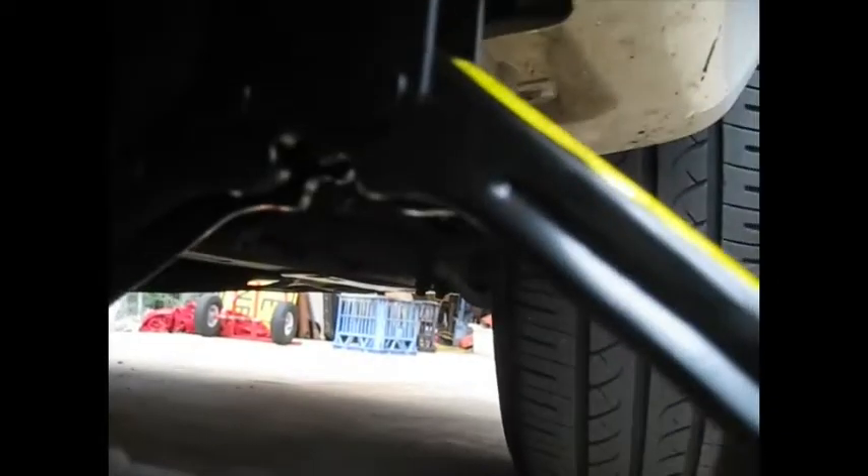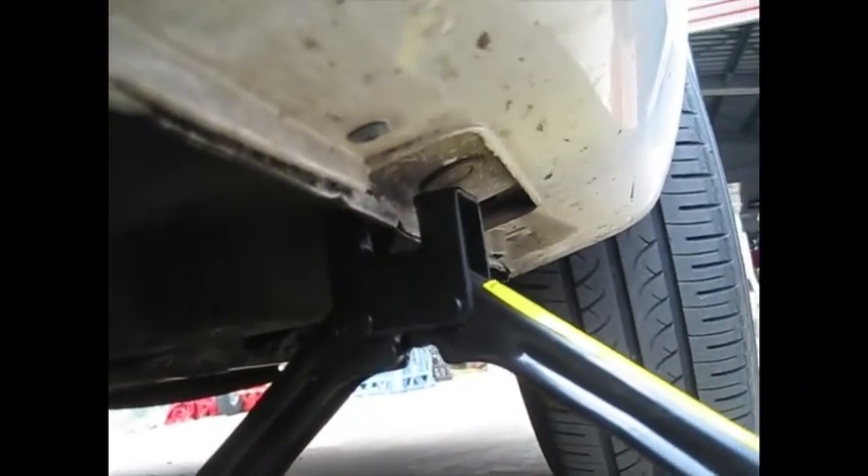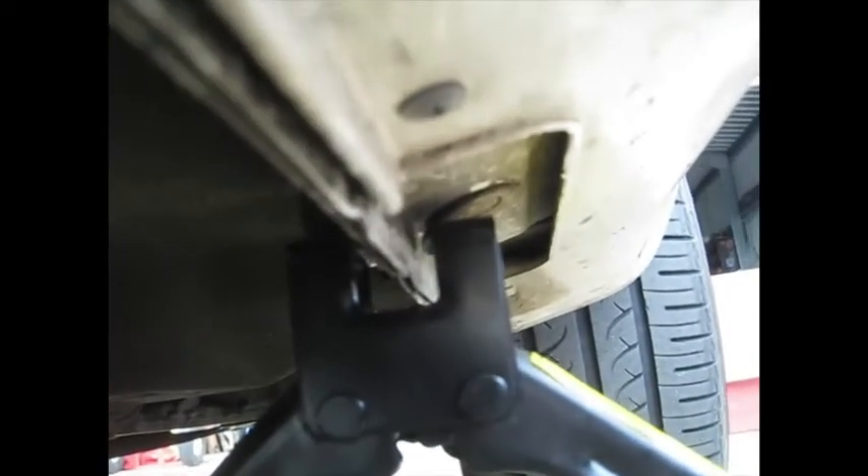If you get under your car here, this is all plastic here, but there's a cutout. There's one at the back, there's one here at the front, and also under here there's this solid piece. What you do — you notice your jack. So he goes under there, and you make sure that goes in the rib there, and it also sits on that tag up in here, and this sits in your guttering, like so. And then you jack your wheel up.